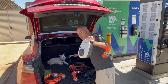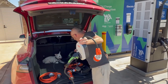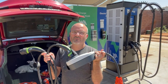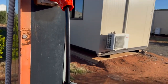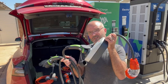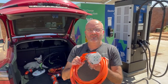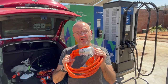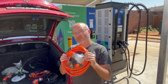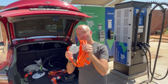I can plug the Type 2 cable into the Fronius and the other end into the car. With this setup I can get the fastest AC charging available, which is 11 kilowatts for my Tesla Model Y. Some EVs will actually draw up to 22 kilowatts, but with this setup I can do 11 kilowatts, getting back about 65 kilometers of range per hour. The last cable I've brought along is a three-phase extension lead — so if the three-phase plug at a roadhouse or industrial setting is too far from where the car is parked, I'll just pull out the three-phase extension lead. It's a pretty chunky cable.